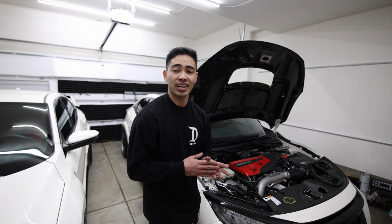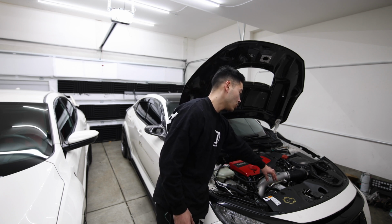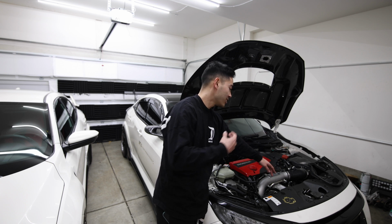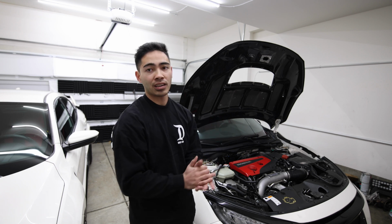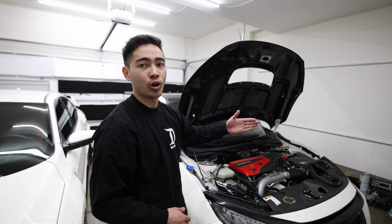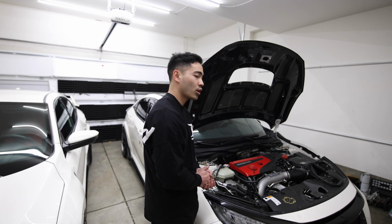And what I had to do to fix that is recalibrate it. On the wastegate itself, there's two nuts. There's a nut with a heat shield on it, and that's a locking nut. And then there's the adjustment on the other side. So what I had to do was adjust it and get it back to spec to have the wastegate function properly, all the way open and all the way closed. That seemed to solve the issue, and so far it's running great.